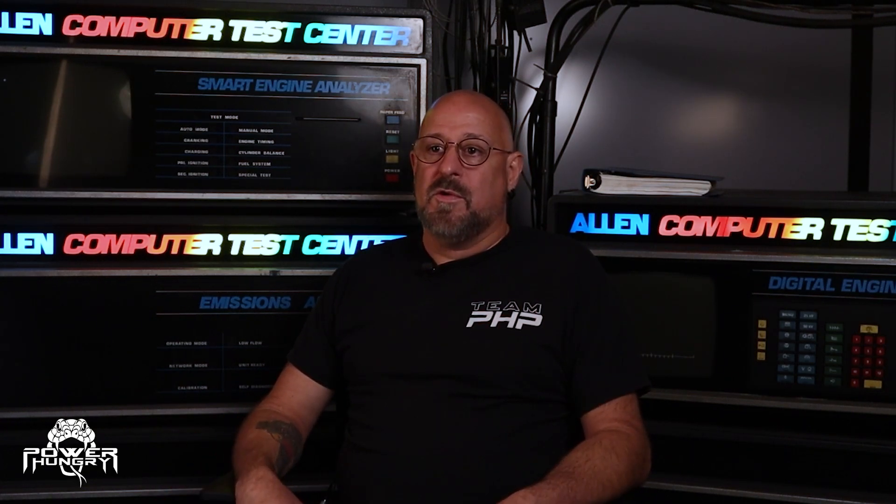We just finished up the PID monitoring capabilities of the software so we can actually do live data now. We can live data log it, we can store the files, and you can see if there's a system on the vehicle that's starting to fall off. The high pressure oil systems on these engines are a common problem as these vehicles age, so you can see if your pressures are falling off. We can also detect trouble codes. If you get a service engine light on your dash, you can plug the software in, run the DTC monitor, and it'll tell you what systems are having issues.